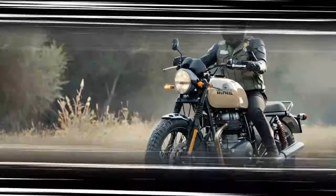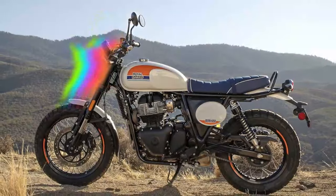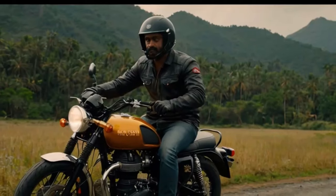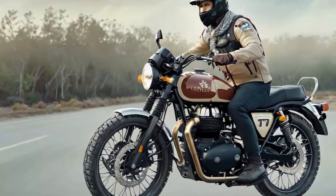The Bear sets itself apart with its revised chassis and suspension setup, designed to handle more adventurous terrain. The taller 43mm Showa inverted front fork and longer rear shocks provide increased suspension travel and ground clearance, boosting capability on uneven trails and enhancing cornering clearance so riders can confidently lean into turns without scraping foot pegs. While the stiffer rear shocks can feel jarring on bumpy roads, the front fork compensates by absorbing rough patches with ease. The 19-inch front and 17-inch rear wheels, combined with model-specific tires, strike a balance between off-road grip and on-road stability, although sandy or loose surfaces reveal its limitations.